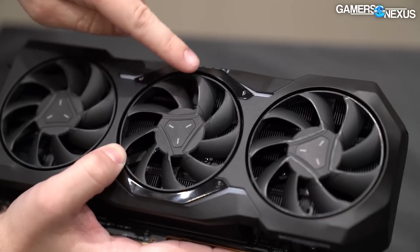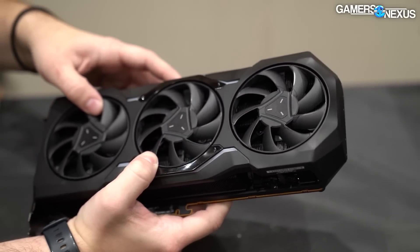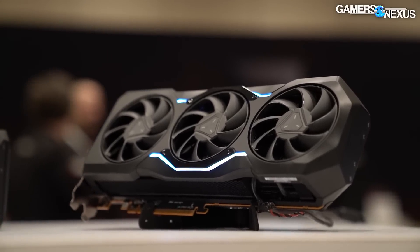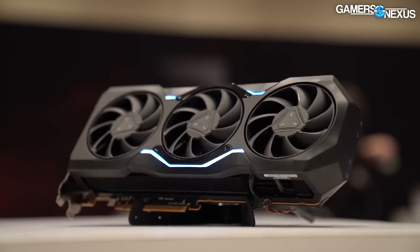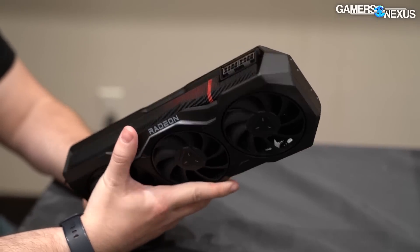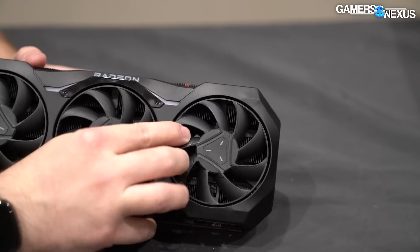Internally underneath, you can see the fin stack, which has some topography — a little elevation at the top and gaps in the middle. Those gaps in some areas are used for cable routing, but mostly they appear to be L-shaped fins used for flow guidance. L-shaped fins that close 90 degrees on one side — top or bottom — are useful for strategically blocking air, forcing it a certain place rather than letting it run freely. The fin stack is a little on the thicker side without going into three-slot territory.